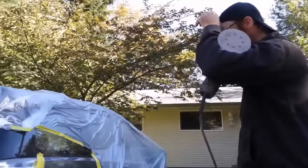After the body work was done, Gerald helped me with some minor touch-up jobs like this one here. I had a pretty bad scratch in there from a parking lot at a mall, and I used one of these paint sticks or paint pens to touch it up, but I put too much on it with a brush, so Gerald just took some lacquer thinner and wiped off the excess paint, and it turned out real nice, looking real good again.